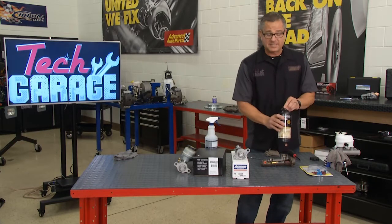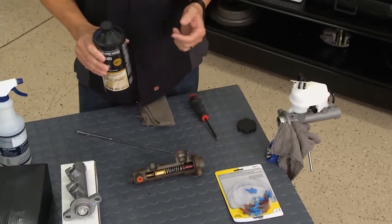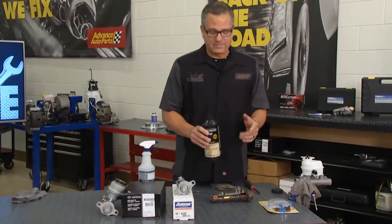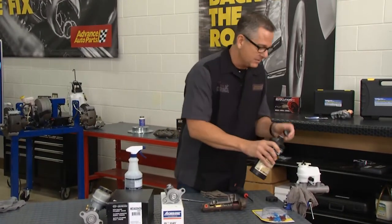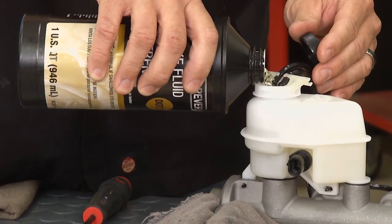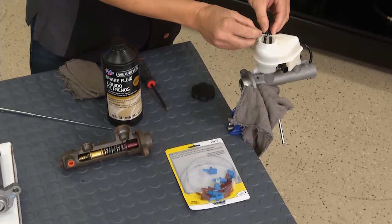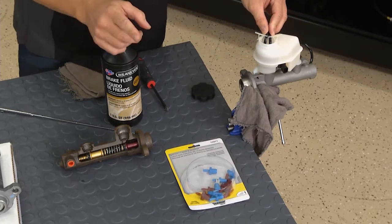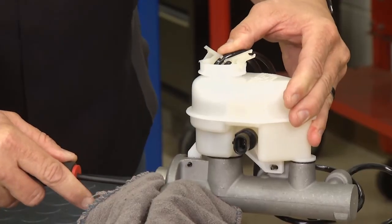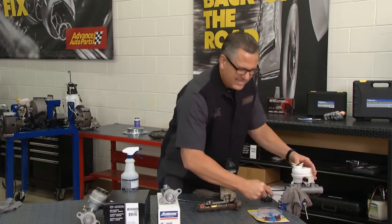It's a real simple process. I'm just going to take some brake fluid here. Make sure you use the right brake fluid — there's DOT 3, 4, 5, and even 5.1. DOT 3, 4, and 5.1 are glycol-based; DOT 5 is silicone-based. We're going to use DOT 3. The higher the number, the higher the boiling point. I went to Advance and got a bleeder kit — nothing more than some hoses and fittings. I put them into the master cylinder, submerged the lines, and you can actually see the bubbles in there as the air purges out.